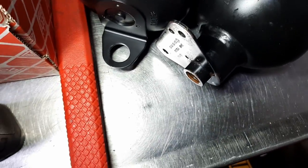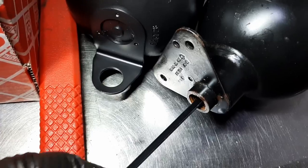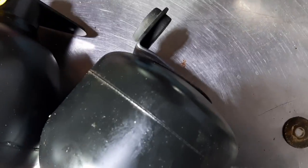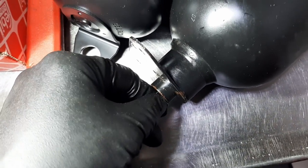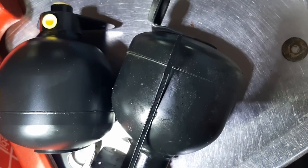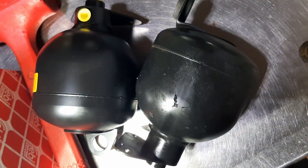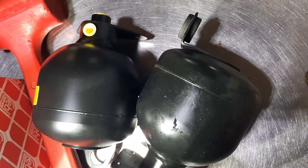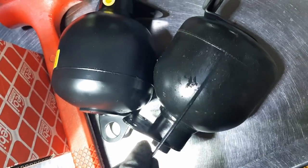Easy now. So if I take a zip tie that I have and I poke it right there, I can see how far it reaches. And if it reaches all the way to the back, it means that the diaphragm is corrupted or rather ruptured, and it no longer provides a seal. So yeah, you can see that the zip tie went all the way down back there. So the diaphragm here must be torn or something. Anyway, I know for sure that there's no nitrogen here, because I would hit some pressure, you know, and I could never insert the zip tie all the way.